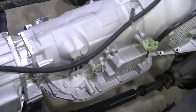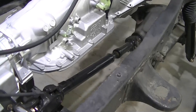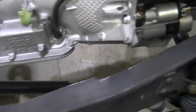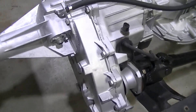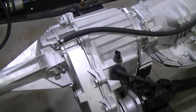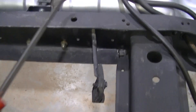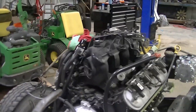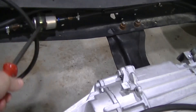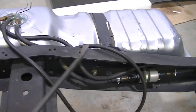We got new front and rear custom drive shafts. Those were from a local shop — about 700 to 750 bucks. They're painted and hook up to your front differential. We've got a new fuel tank from Tanks Inc., with an in-tank sending unit. That sends fuel up to the regulator and into the fuel rail and on into the injectors. There's also an in-rail filter we can change out. Got new gas tank straps. We'll be using a single tank on this setup — don't want to get into a dual tank.